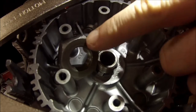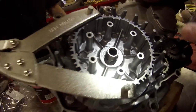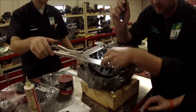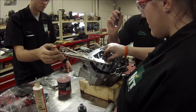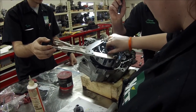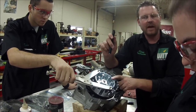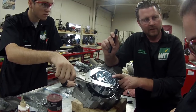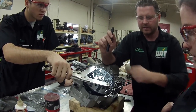We're going to demonstrate that now and show that when we pull torque on this, it'll actually be loose. Let's put that on wrong. We'll just torque it to half torque — this actually calls for 65 pounds, which is common for these large diameter nuts.